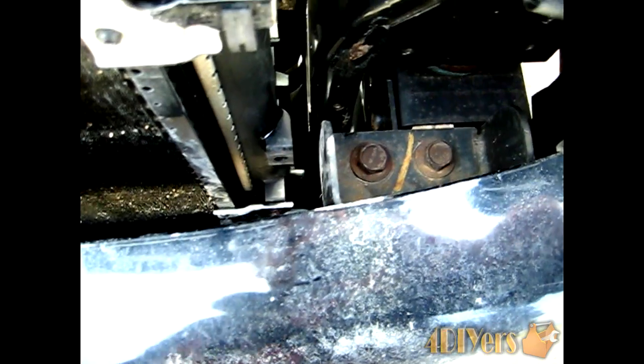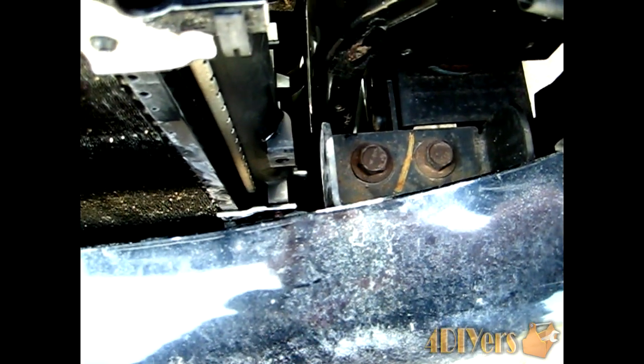So what you'll have to do is actually angle the pan in such a way so it actually does drain onto the plastics itself and then into the pan. Now in order to pull the plug out, you just have to pull it straight out. It's just a quarter turn style plug here.